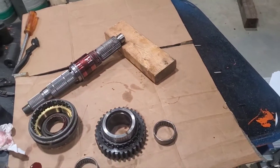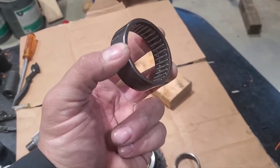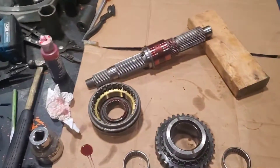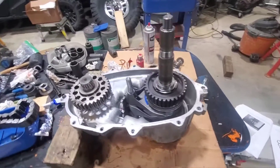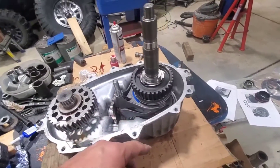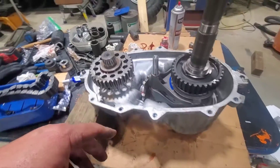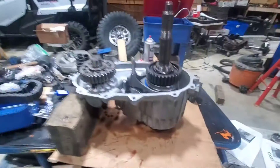If I had read the instructions first instead of assuming — I went to slide the assembly over the new shaft, but the bearings don't slide over the new shaft. Read the instructions: it says remove needle bearings if present. Most of the case has been reassembled. I'm basically at the point to put the chain back on. All the mechanical levers and stuff have been re-seated, everything's oriented right, everything's got plenty of assembly lube. A couple of new seals have been put in — there's an O-ring in the mechanical lever rod area, a front seal, and then the front here has a cap and a seal.